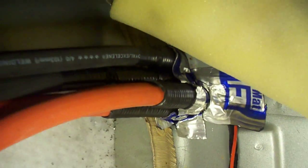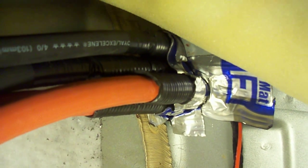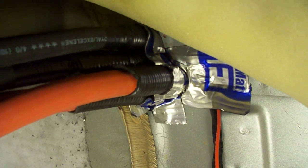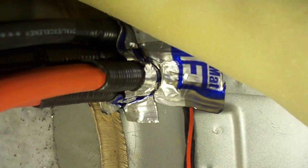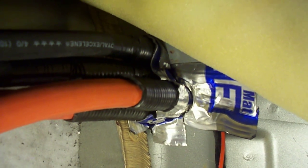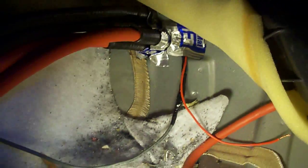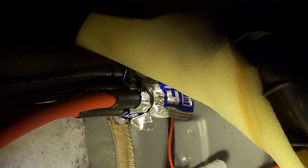The wire already has a really strong shield on it. Most of the other wires I've used, when you're pulling them through the firewall and they grab a little chunk of metal, they'll rip and tear. This stuff is pretty tough — it just gets a little scratch on it that usually rubs away. I wrapped the inside of the hole with fat mat, then wrapped the wires with split loom, wrapped in tape, then wrapped in more fat mat, which actually helped it slide through pretty nicely.